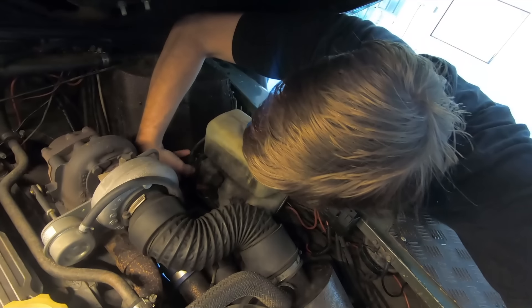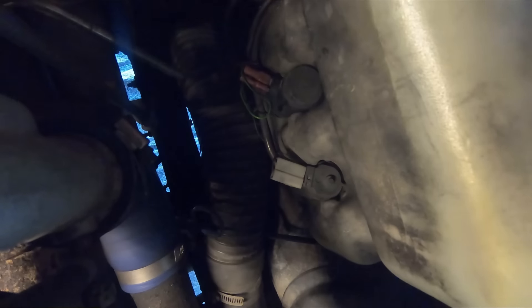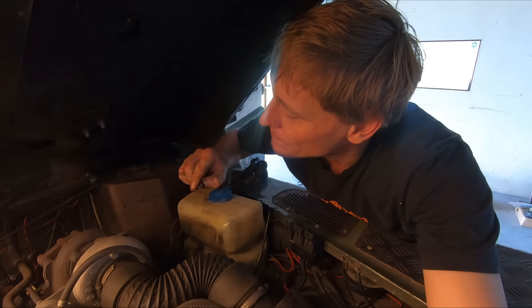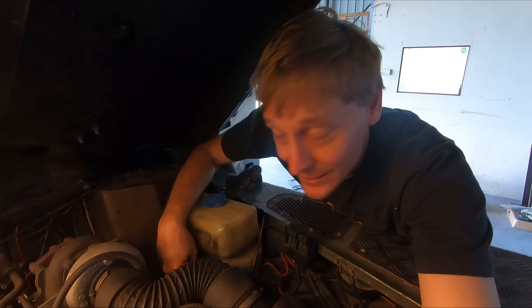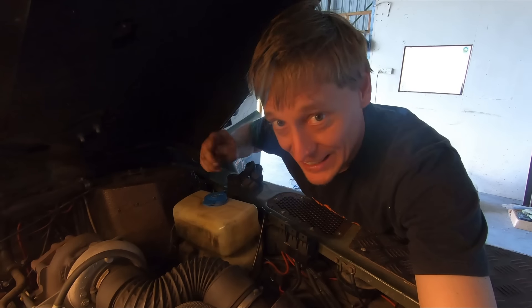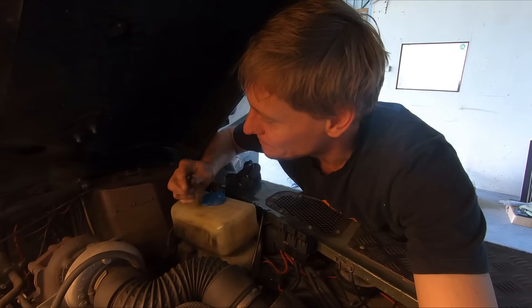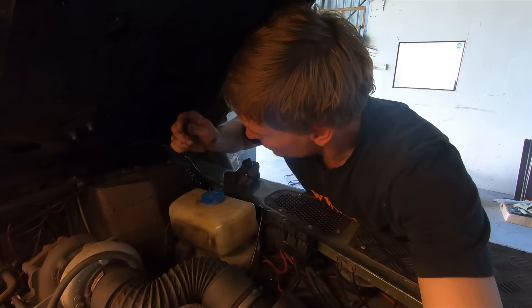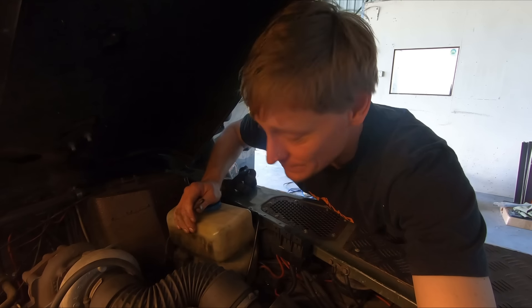Down here might be the culprit — one of these pumps might just be blocked up. In typical Land Rover fashion, while trying to take off the pipe I ended up breaking off the little attachment — the spout that the pipe slides onto. So that's going to need a whole new motor. Trying to blow through the pipe I've disconnected up top, it's completely blocked somewhere and I can't get any water through it. I've already disconnected the one-way valve to see if that helps, but it hasn't done anything. So I'll have to keep tracking this up — maybe replace the motor and some of this hose.